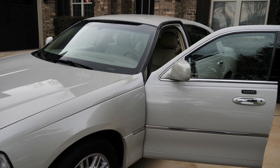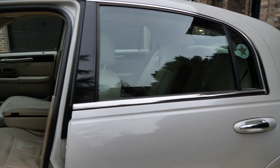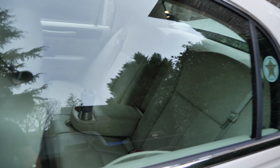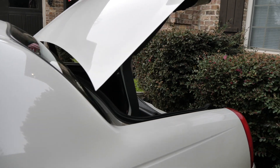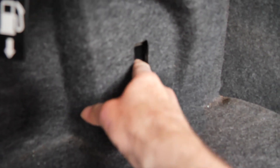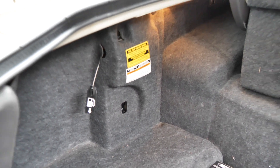In order to fix this we've got to go in the trunk. I'll push that button and that opens up the trunk. What we want to do is shut off this switch right here in the trunk — that's for the suspension. I'll shut that off so the motor can't kick on, even though this one won't kick on because it's broke.